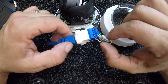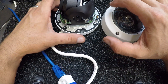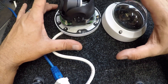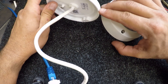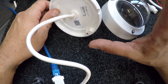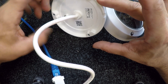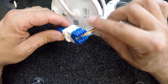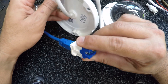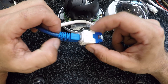I would never try to put this into an all-weather environment, even if it was going into a junction box. The Hikvision junction boxes that go on the back of these cameras look smart and line up beautifully, but they are by no means weatherproof. This little cutout here has a grommet that goes in there and that grommet does not seal at all. So they are by no means a waterproof enclosure, and I still wouldn't bet on it even if you tried to seal it up with silastic.